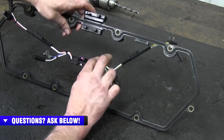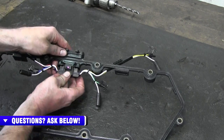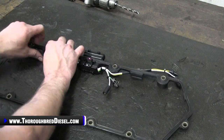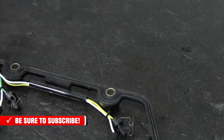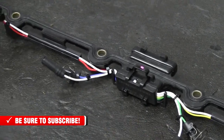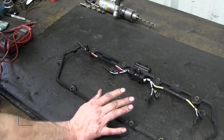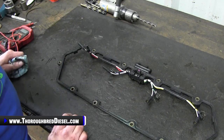Our harness is going to go just like this right here with the connector towards the outside. You want to make sure that you've got good engagement of the spades — the terminals — because you can roll these terminals over. If you roll them over, you've bent them up and there's just about no getting it back at that point. There are plastic connectors here that go on the top side of the harness — this keeps the harnesses up and away from the rocker arms and the push rods. Just go ahead and pop those in there. So now at this point, this assembly is ready for you to drop in the truck. You can look at your old wiring harness and see which way the reds, blues, yellows, and greens go so you know you've got everything facing the right way. That's how you assemble the harness — I like to assemble them out here on the bench before I throw them in the truck.